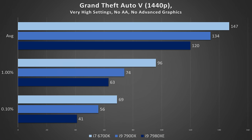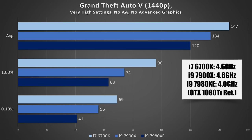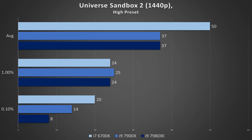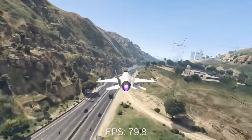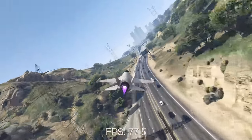To be clear, this isn't a gaming CPU. 18 cores is severe overhead — we'd be lucky to utilize half of them. The benchmarks here show no promises at all. In fact, GTA 5 was underperforming relative to our 7900X. Thanks to its lower clock speed, it's just more difficult to reach the same overclocks with a higher core count chip. On top of that, I couldn't reach 4.6GHz because this CPU just gets so hot. Doom was a similar story — once we passed a certain core threshold, the only thing holding us back is frequency. 4GHz just isn't cutting it, and we're performing about on par with 8-core Ryzen CPUs that cost about 6 times less.